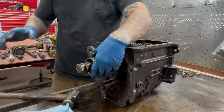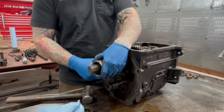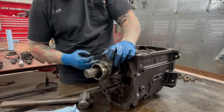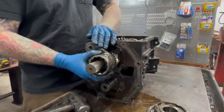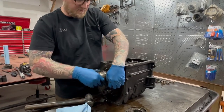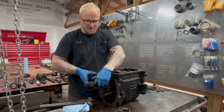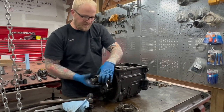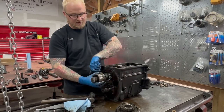For tightening these nuts I've got a nice heavy steel table with a piece of angle iron on the bottom. I put a metal piece of strapping from the tail housing hole to that hole in the angle iron so I can torque it to 300-plus foot-pounds really steady. But for taking these nuts off — especially if they're used and old — you can simply lock it in two gears, get a typical fifth gear nut tool, and just smack it with a heavy hammer and it'll come right off. Sometimes when I have to get back into one I've built it's normally like a three-person job.